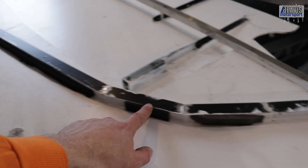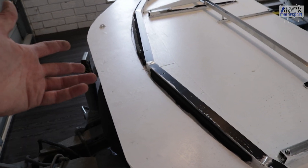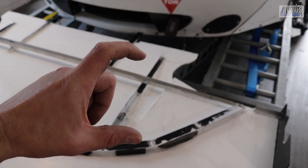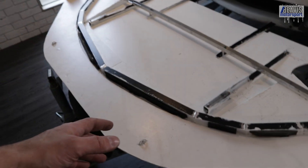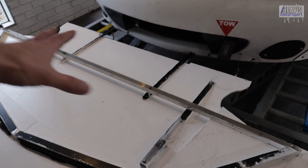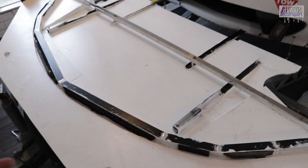There's also an aluminium box tube that I cut and welded to match the curve of the front bumper. This adds rigidity, keeps things squared up, and also serves as a front edge for the front plastic air dam. This is a bit of garden trim that sits between the bumper and the splitter — there's about a two-to-four inch gap between them filled with that plastic trim, reused from the old splitter. There's also some horizontal bracing across the top that keeps the entire splitter quite stiff and stops it flexing, particularly at the extremities, which are supported by the steel wires.